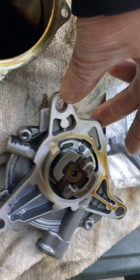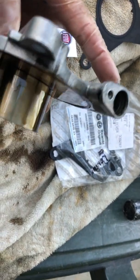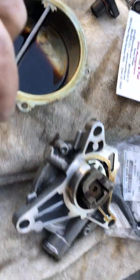This is the part you may have seen on a previous video — this is my old one. The little outlet here for the vacuum actually comes out here. There's a little fitting — that's this piece right here. It takes a T25 to take it out. It has a little filter there that's supposed to pull air, and mine was pulling oil.